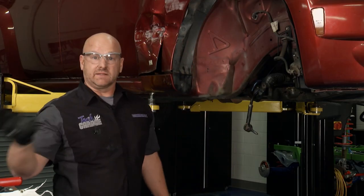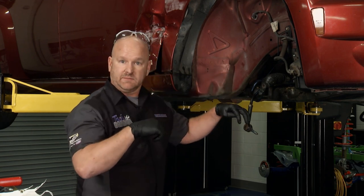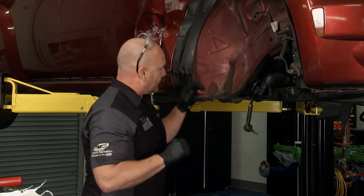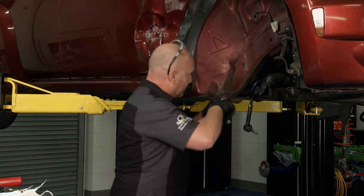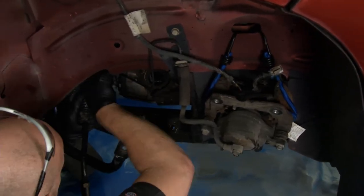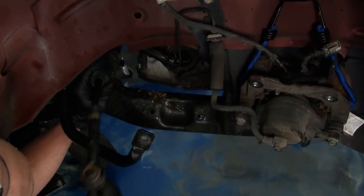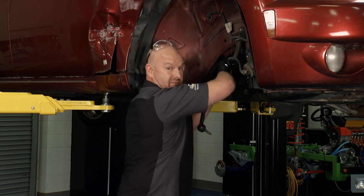You have to get the steering rack out. There are two bolts that come down through the top — they're 18 millimeter, not that hard to get to with everything removed. Then we just have the steering knuckle to remove. This joker's coming out. I'm going to take it over to John — see if he wants to play a game of horseshoes. Pulling slightly to the right, John. Why don't you tell us how steering systems actually work?